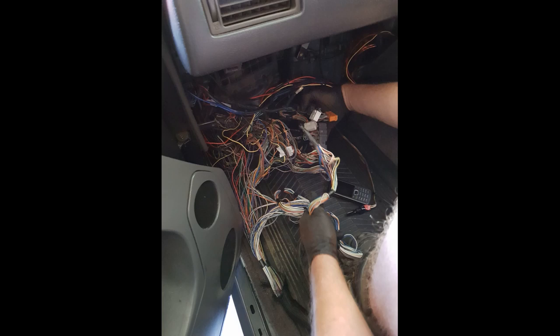Another young owner has got it and somehow managed to pop the engine. He did say the last one went very well and showed me the camshafts out of it - they definitely were not standard camshafts. So when they went to fit the engine, they got a 20 series Gen 2, where the original engine was a Sora engine, and instead of just changing the block and heads they attempted to change some wiring as well. The wiring wasn't that tidy apparently to begin with, and now the vehicle doesn't run.